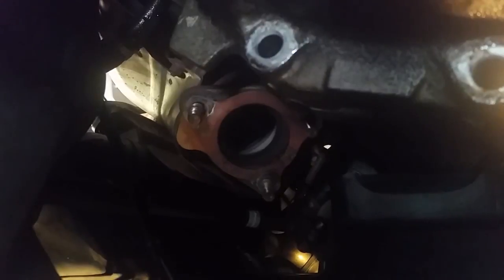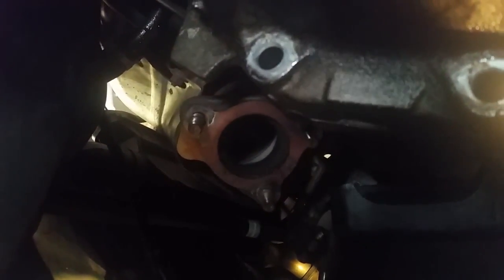There's the exhaust — I have it out now. Just three bolts. I soaked those with penetrating oil at the beginning, which is why it wasn't that hard to take out. Make sure you do that — it'll make taking everything apart a lot easier. There's the slave cylinder. There are two 12mm bolts holding it — you just take those out and it will slide free.